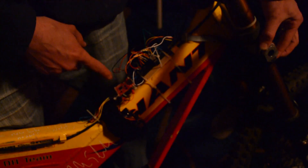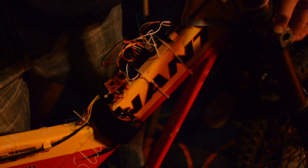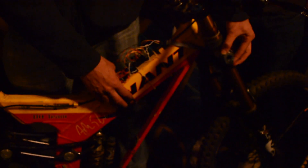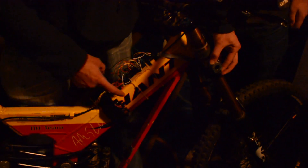So that got us the front suspension. We wanted to do one for the rear as well, but we were running out of time, so we were picking our battles. We also put an IMU on there to get nine degrees of motion as a base reference point. We wanted to put another one on the front wheel, another one in the rear, and then compare what the rear and front are doing in relation to the center frame. And as a final thing, we put an IR gate on the back using the holes in the disc to calculate wheel speed.